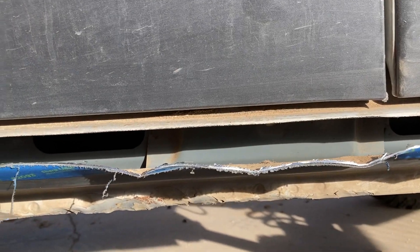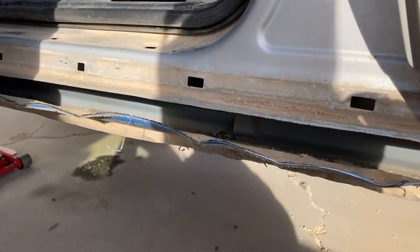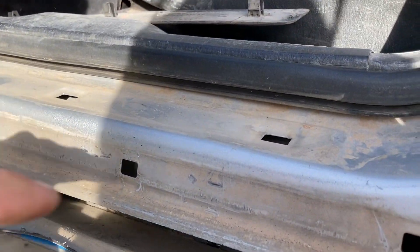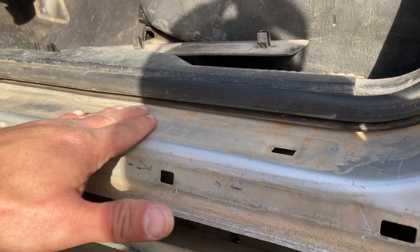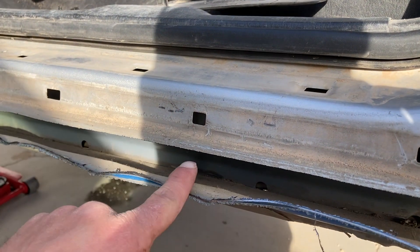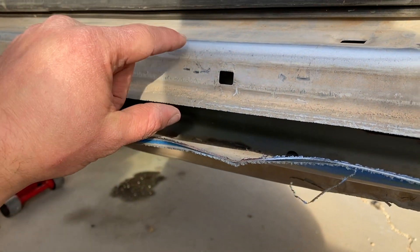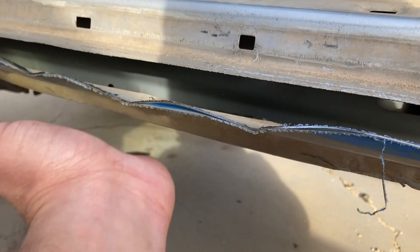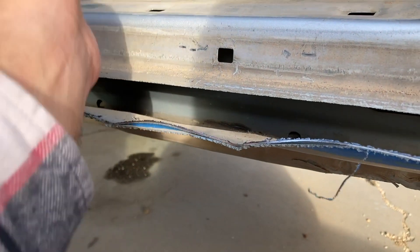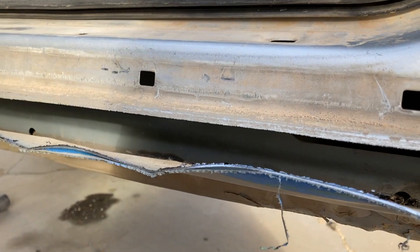That's basically where your support comes from if you roll the truck. So we're going to have to figure out a way to support that, because on a ZJ when they close, this is the lip you're cutting, and your square tubing slides under there — that's where your support comes from. But on a WJ, the flashing goes down farther, so there's nothing above that. If I were to slide that tube in there right now, I've got about two inches of dead space with no support. So if a rock comes up and smashes it on the bottom, you're just going to bend that piece of tubing straight up over your door — you won't be able to open your door because the rock slider will fold around the outside edge.